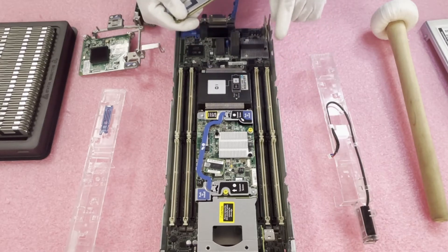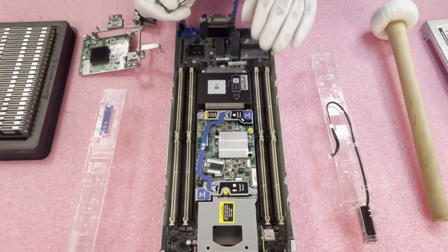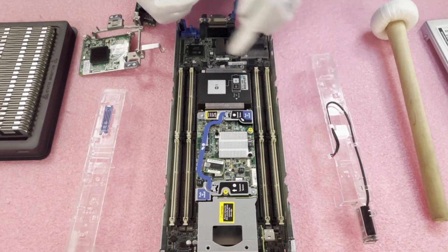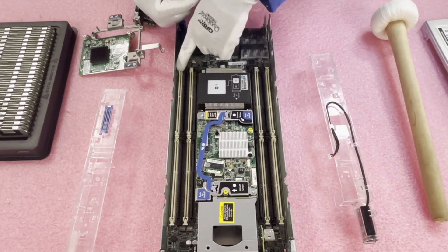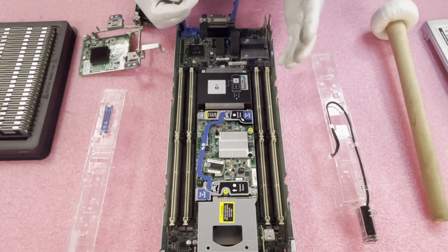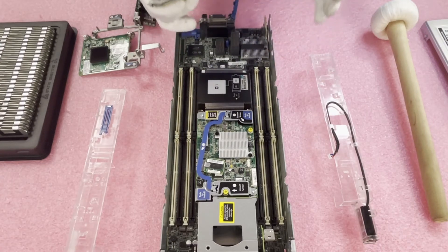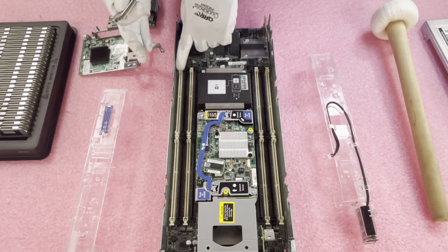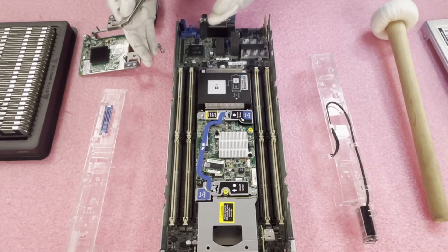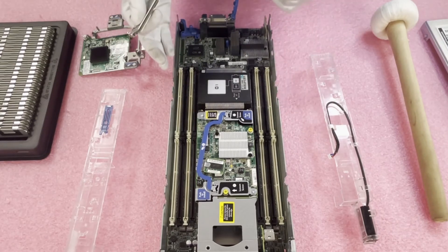It's also important to note that the start of the memory channel is the white slot. So if you were not maxing this out — let's say you were putting four DIMMs in — you would use white, white, white, white. If you were putting eight DIMMs in, assuming you have two CPUs, you would go white, white, white, white, white, white, white, white, basically skipping all the blacks. The reason to do this is you want to have the proper balance across the load. If you were to put two modules only in one channel, you're getting nothing out of the other channels. It's based on performance and making sure you're doing the best for load management.